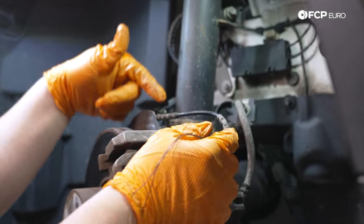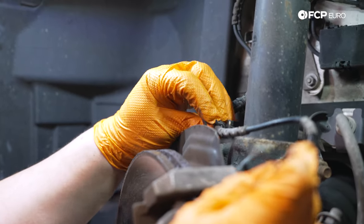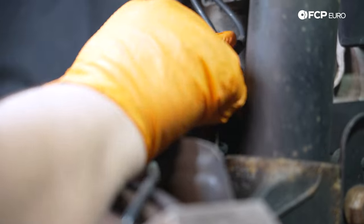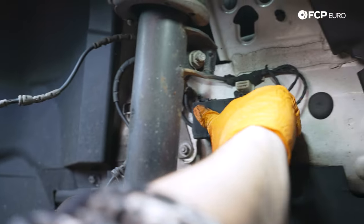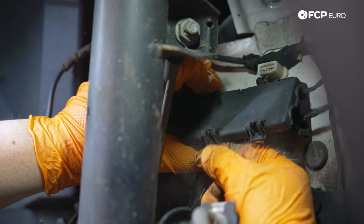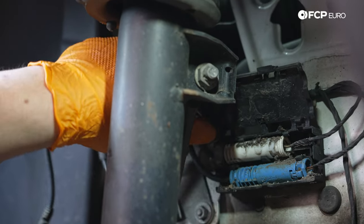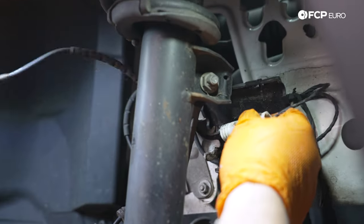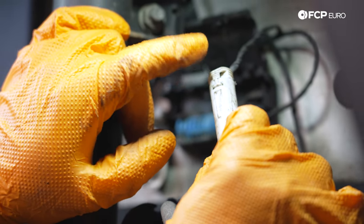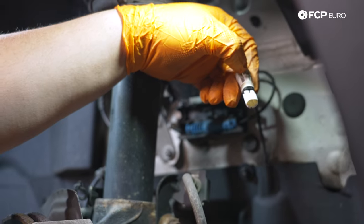Following up the top of the knuckle, there's a small black plastic clip holding the line in place — just pop it open and sneak the wire out. Moving along, there's a small metal tab that retains the line as well. Then there's a junction box with a small metal tab in front of it — open it from the bottom. There's usually a ton of debris in there, so it's a good time to clean it out. Pull the cable from the last tab and you have your old brake pad wear sensor. Press in the locking tab on the harness end of the vehicle, pull the sensor out, and throw it in the trash.